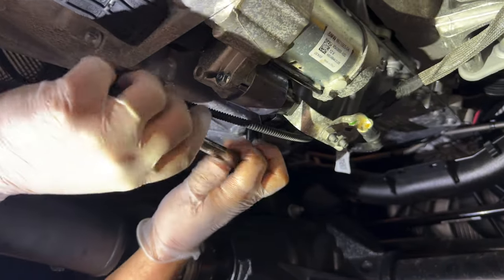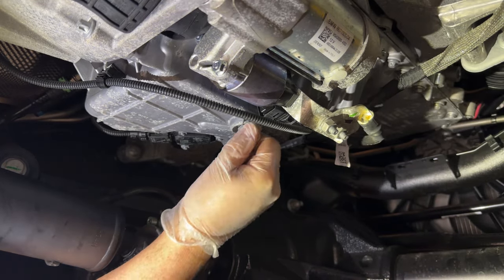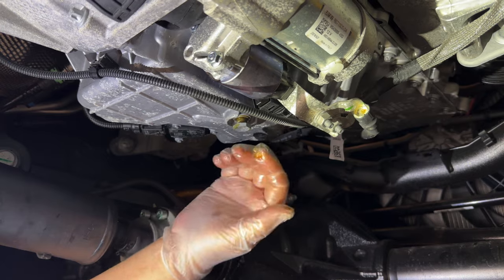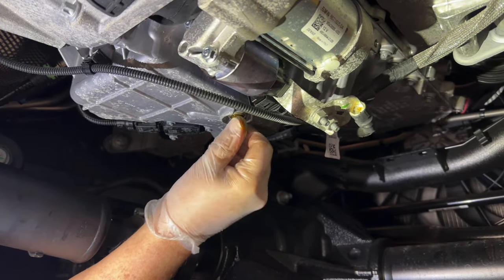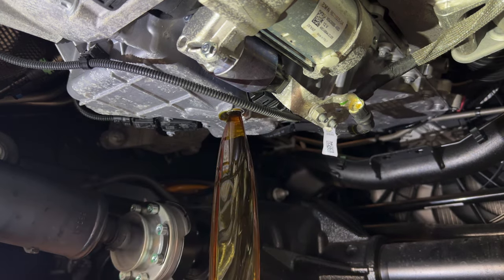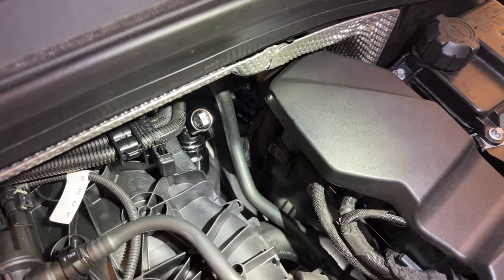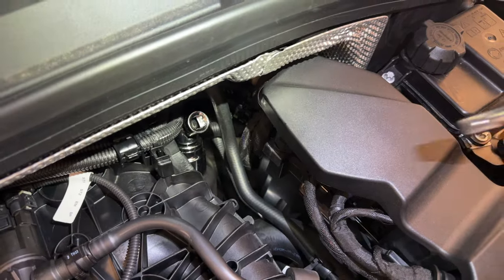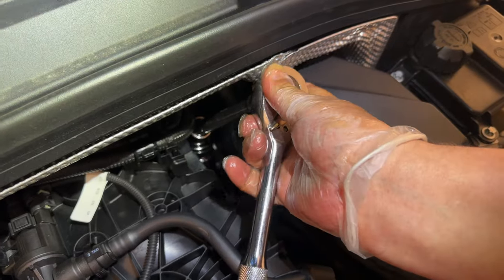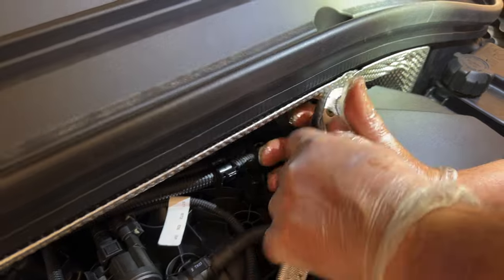I'm going to do this very slowly because this is the first time I've changed the oil in this vehicle. I want to make sure that what comes out of this hole is motor oil — and it sure looks like motor oil, pretty fresh motor oil actually. We've only got 1100 miles on this fill, but we do want to get that break-in oil out. Make sure you have a rag down here to wipe off your drain plug. The drain plug is at an acute angle, but once loose I cracked it free and let the oil drain.